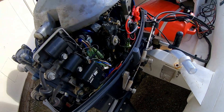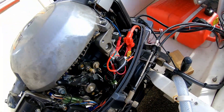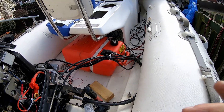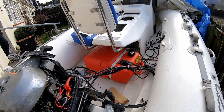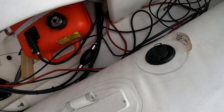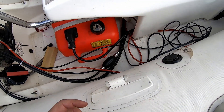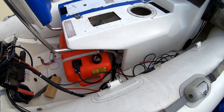We've got sunshine now — thank goodness. Everything is neat and tidy, just a cable tie around the fuse, a five-amp fuse in it, and the positive and negative cable-tied just underneath the seat. I can get the battery in and through that hole underneath the seat, so that's the next job. Also need to drill out for the ignition switch. Put together a bracket loosely fastened at the moment — that's where the battery is going to go. The cables are here so they just need to pass up, curve up, and onto the battery.